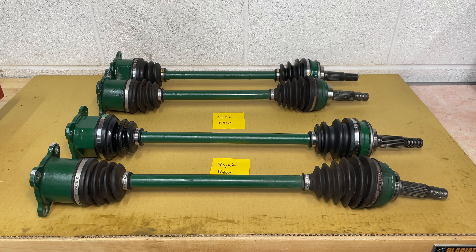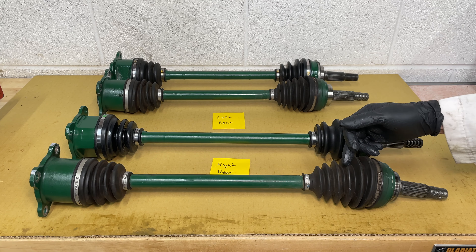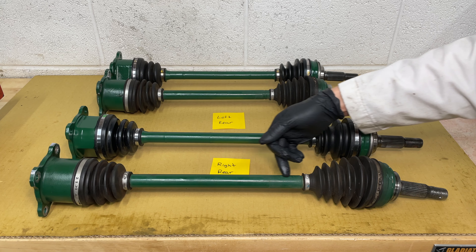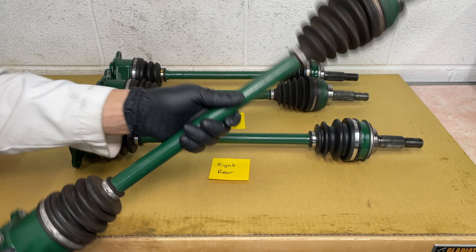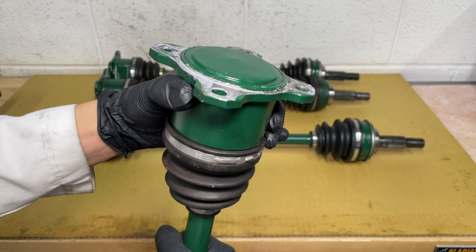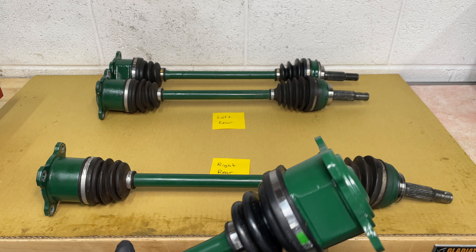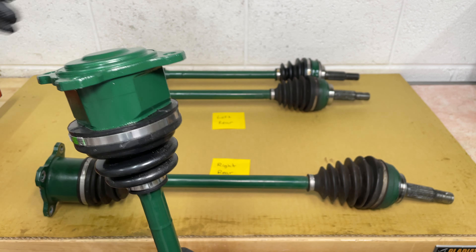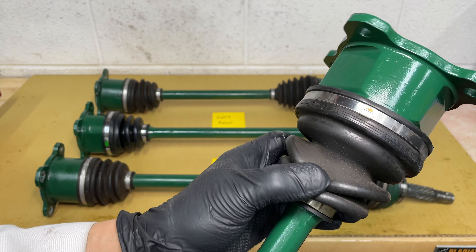Let's compare these axles. The right rear CV axle is longer than the left rear. The AutoZone axle has many ridges on the outer CV boot; the Toyota axle has three ridges. The AutoZone axle has a smooth shaft in the middle; the Toyota shaft has three ridges. I bought these axles from AutoZone three years ago and put 8,000 miles on them, and the inner CV joint has a lot of play side to side and clunks when you drive. I bought these Toyota CV axles from the junkyard — they have about 200,000 miles, they're 24 years old, and there's zero play in the inner CV joint. The Toyota axles have some dry rot on the CV boots, but they're not torn yet — I will replace these.